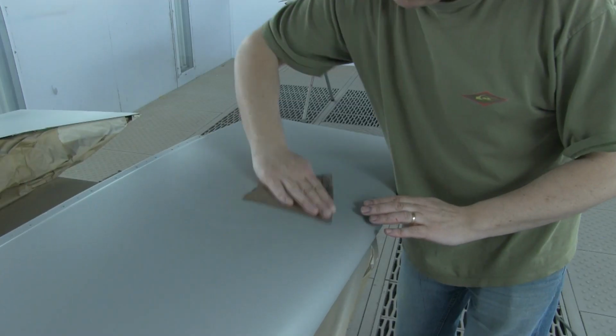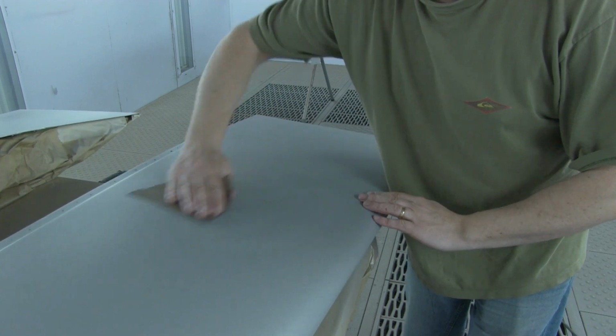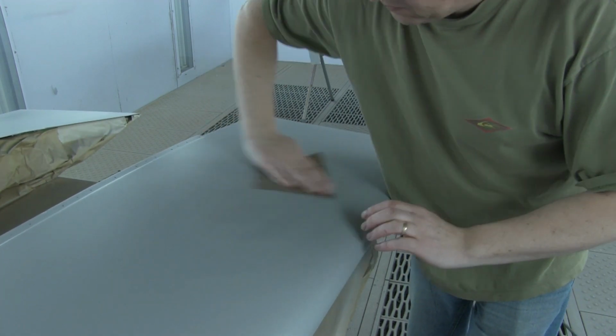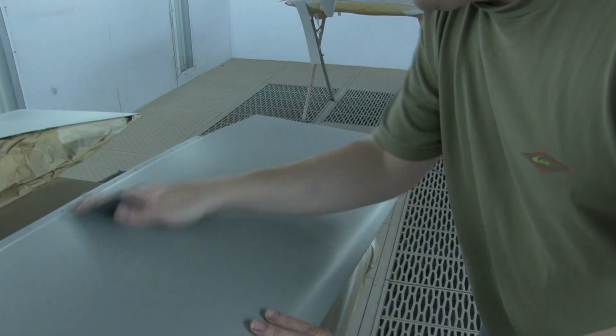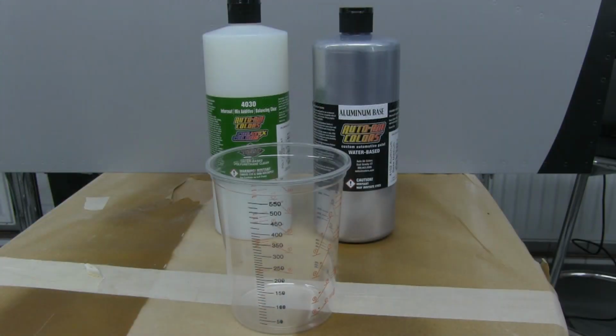And you can see all the areas where I had the bare alloy from the product failure of the etch primer completely gone. If you get any bits of dirt, you know you're going to at some stage, I can just come in and denib. Guys, this is less than 1 hour, okay? Less than 1 hour, and I'm aggressively dry sanding this sealer.